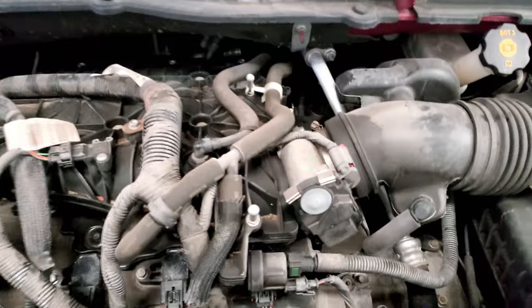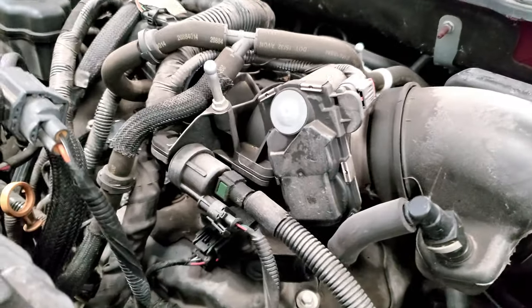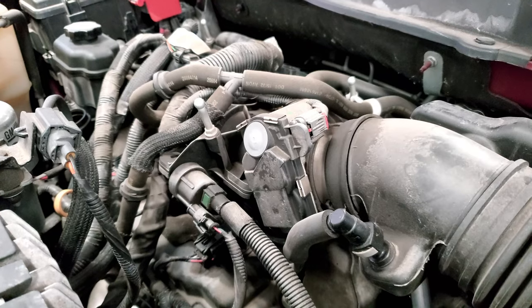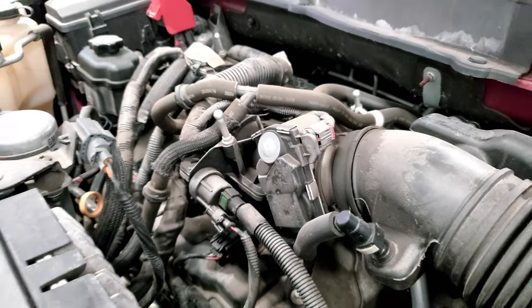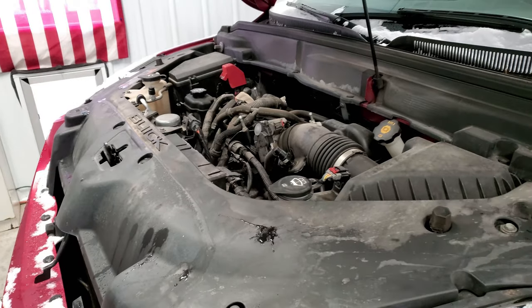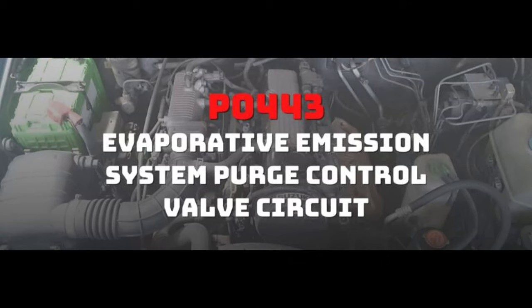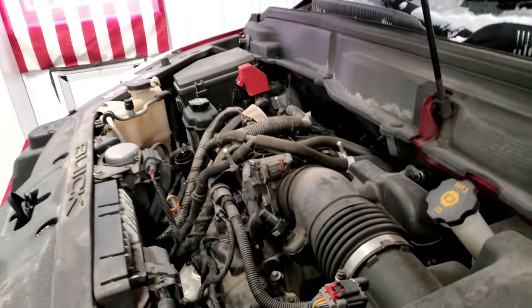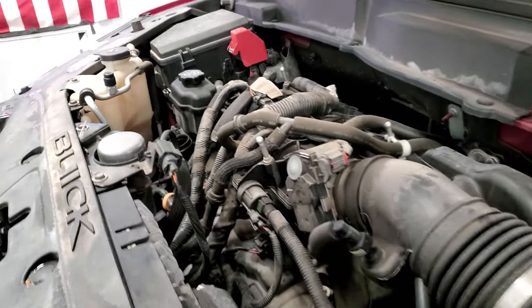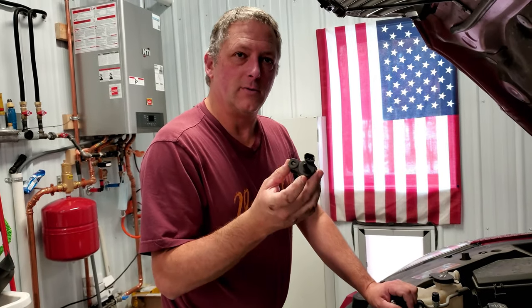Now you're in the area where you need to be. This is the culprit — this is called the purge evaporator. You can look up the make and model of your car to find out exactly where your purge valve is. The culprit is called a purge valve, or a vapor canister purge valve solenoid — also called an evaporative emission system high purge flow. That's what the code shows when you use the adapter that plugs in under your dash. Even before you buy the part, you can pull this out and simply test it: blow through it. If air goes through, it's broken — you need a new one.